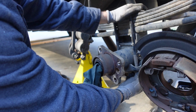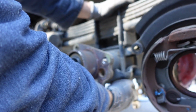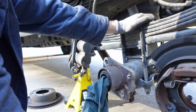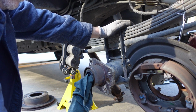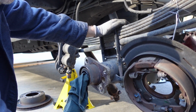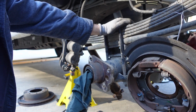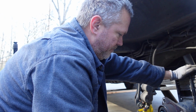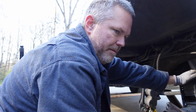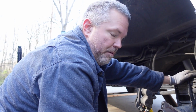We'll unbolt these U-bolts, and the axle should just lower. We'll put some dollies down here. We got some 4-wheel dollies in there from furniture mover and dollies. We'll put under here, and then we'll be able to roll this axle out. And then tomorrow, because we got to paint the other axle before we put it in, we're gonna have to do that tonight and tomorrow. So once we get this dropped out of here, that'll be it for today.